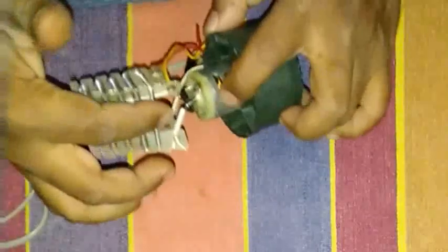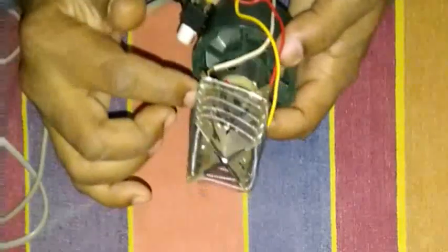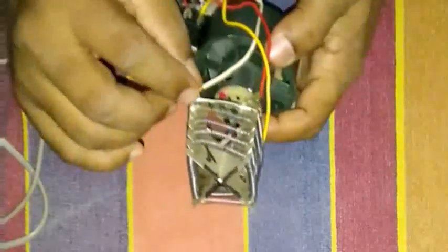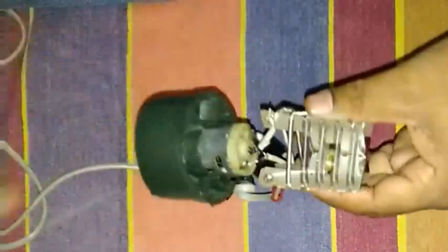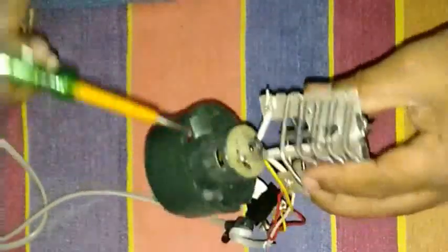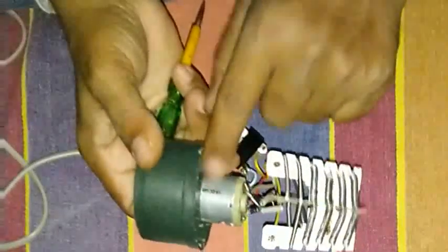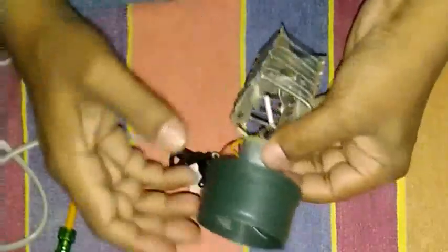This is the high speed motor. For a rectifier, because the motor is a DC motor, the supply is going through a resistor, then the rectifier converts it into DC. The motor is a DC motor — a universal motor. This is the rectifier, and this is the DC motor. The supply is going through the rectifier and resistance to the motor, and the heater has direct supply.